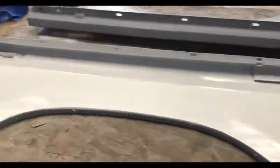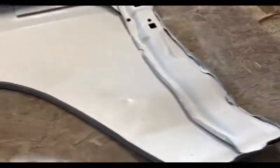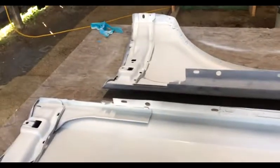All right, here we are. Actually, my paint. I was wanting to put another coat on there, but my can ran out of paint. Not worry about looks as much as just a little protection. Went with the white because that's what my final exterior color of the truck will be. As you can see, I got some tiger stripes there where it's not covered real well. But with epoxy underneath, I think it'll be fine.